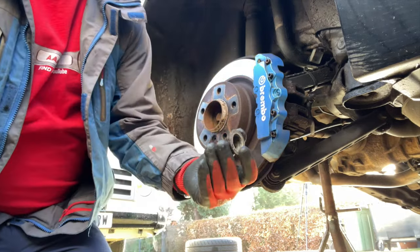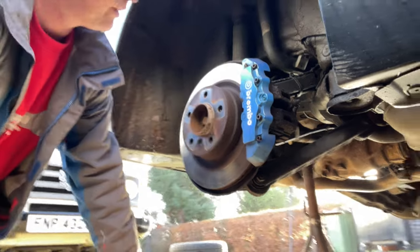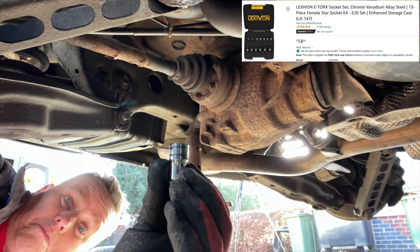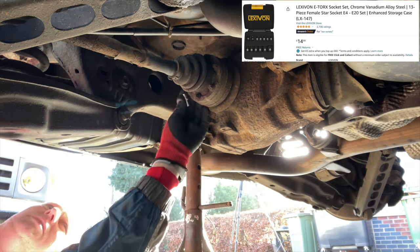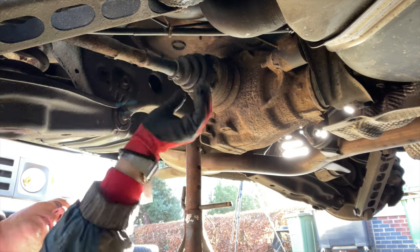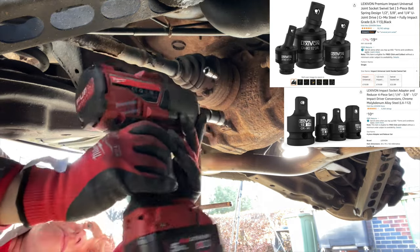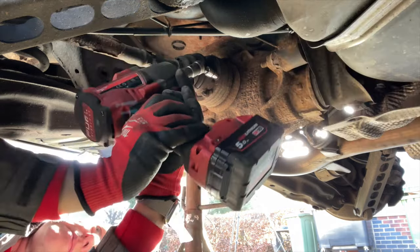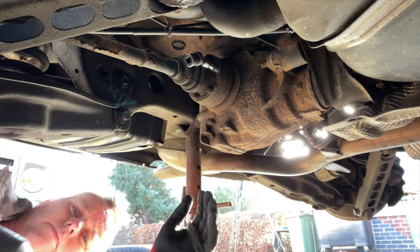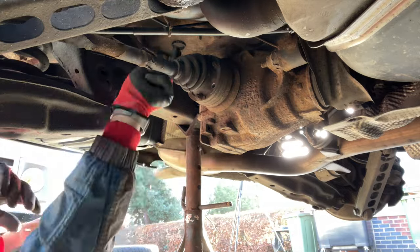Don't mess with a Milwaukee gun — look at that, it's tight. Underneath we've got the driveshaft. E12 sockets are pretty good — you can get quite a lot of grip on them, whereas the normal nuts corrode and round off. These ones don't seem to round off as much. But the boot on these driveshafts interferes with the socket — you struggle to get on at the bottom. You have to try and get on at the top of the driveshaft when it's in that angled position, because the boot does tend to get in the way. It's a bit fiddly.